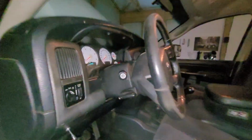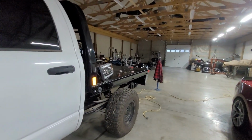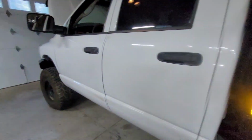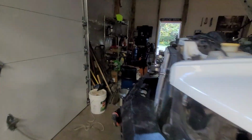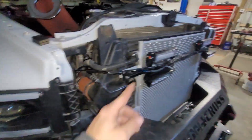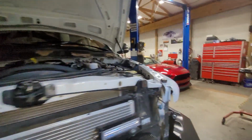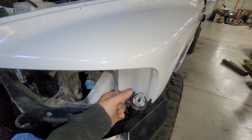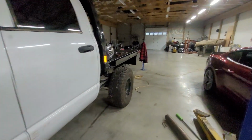I've even put the back wheels up in the air and let it drive at like 5-10 miles an hour, and the speedometer did not change. I fixed the tachometer, the tone ring, and that did not fix anything. It's close enough now that everything should be reading. So somewhere along the lines, we're having an issue back there with it not reading. But we need to get that replaced, and then that's bada bing, done, working.